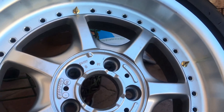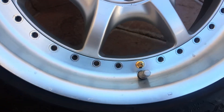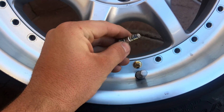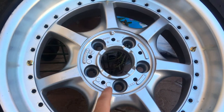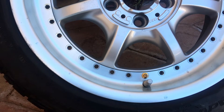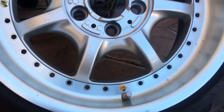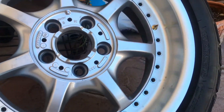This is a pain — these bolts are made for RS wheels, so they wiggle a little bit. I have to hammer the original bolts back in with a spline so I can line up the face, because the valve stem and that little dot are supposed to be lined up. Then these holes can be turned just a little bit with the RS bolts, so I have to line them back up with the original bolts before I can put those in.